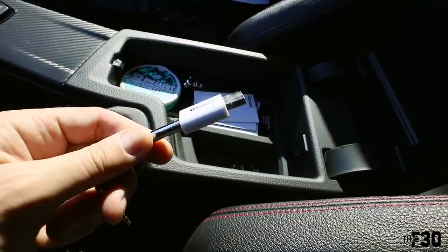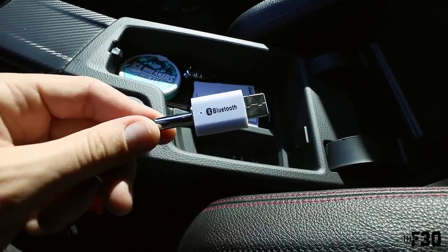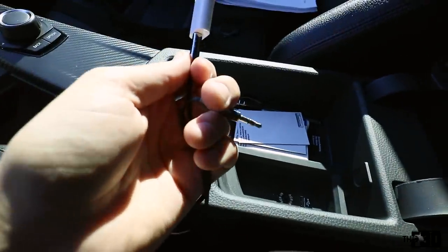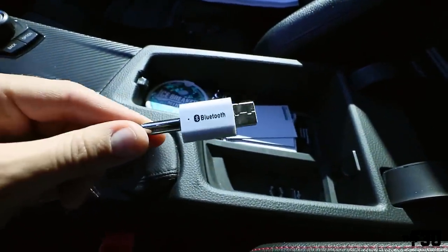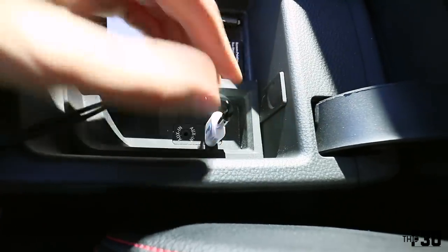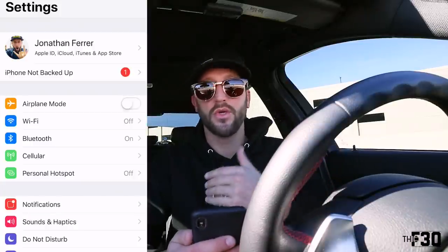If you don't have a comm box and you are like me, this is what you're gonna be doing. You're going to be buying one of these. I will put a link in the description to it. Basically, it's just a little USB Bluetooth adapter. It plugs right into that USB port there, and then it has an audio cable that runs out of it, and it plugs into the audio here. What this does is it communicates with your phone and allows you to stream music from the phone to the car. Go ahead and plug the USB adapter in like that. Take your audio cable, plug it in like that. And then you're gonna see the screen pop up again over here. I'm gonna show you the phone and show you how we connect it.